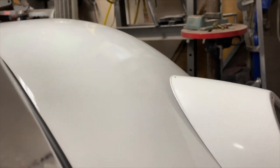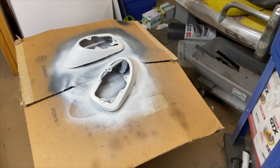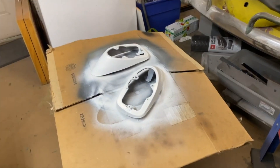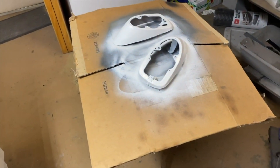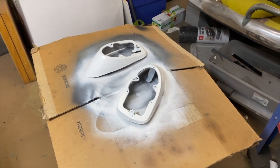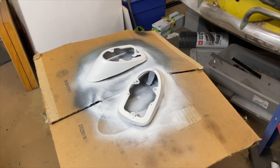This side seems a little better but still needs to be trimmed - the other side seems a lot worse, so it must have been positioned differently on the fender. To get the taillights to contour the bottom of the fenders, I actually had to grind off the bottom edge to round it a little bit. Now I've got them sitting and drying - repainted them again, put it on pretty thick this time, probably going to have to do a little color sanding.